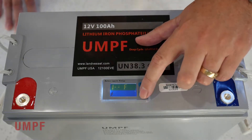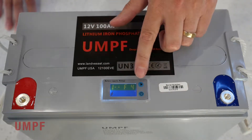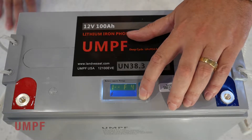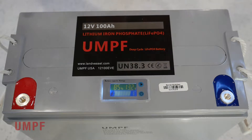There we go. Now we're going to be looking for the number 4. 1F4 is the correct setting to reset this battery. Now you hold the power button until just the 1 appears, and then you hold the play button. Now the battery is completely reset and ready for use.